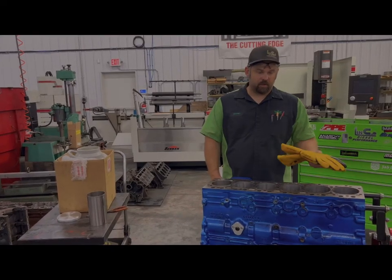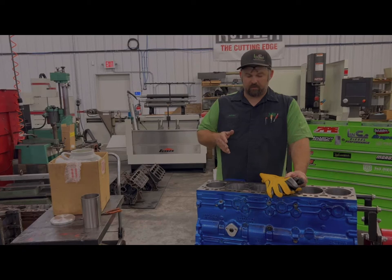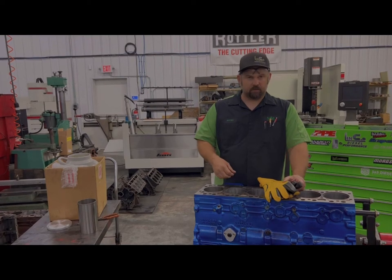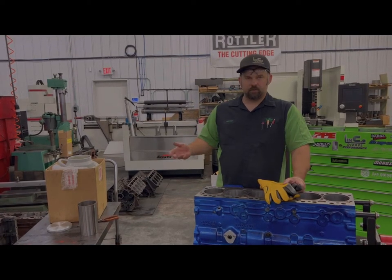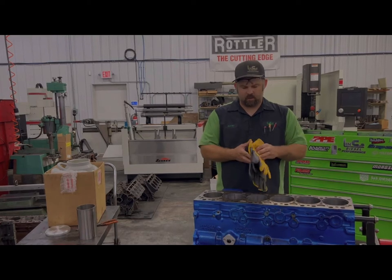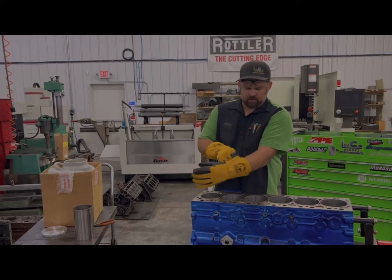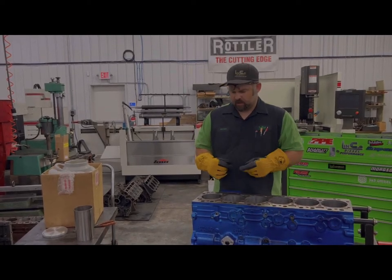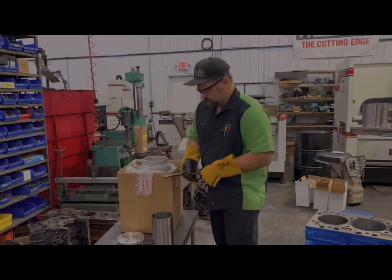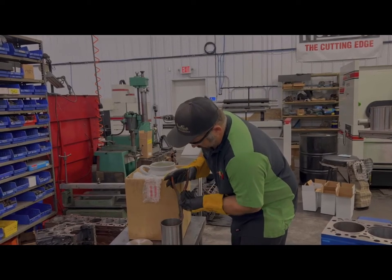After honing, we've got to put the sleeves in. There are many different ways — some people drive them in with a hammer, some with a wood block and large hammer, some press them in. We use liquid nitrogen: it shrinks them and they drop in effortlessly, as we're going to show you. We also have another step afterward to ensure they're seated all the way, because that is key, and we want to prevent any galling between the sleeve and the bore surface. We've got our liquid nitrogen — you always have to use safety precautions with liquid nitrogen.